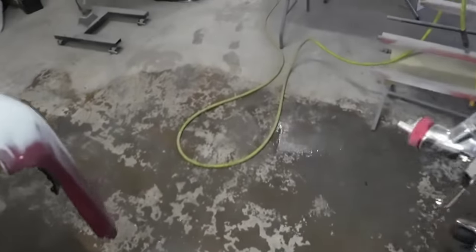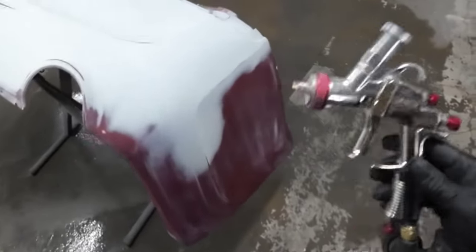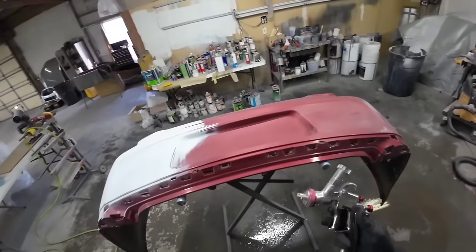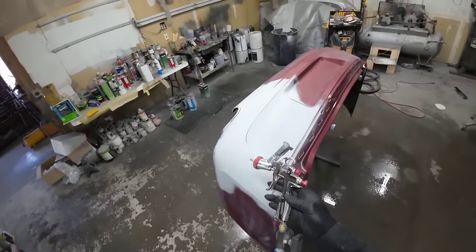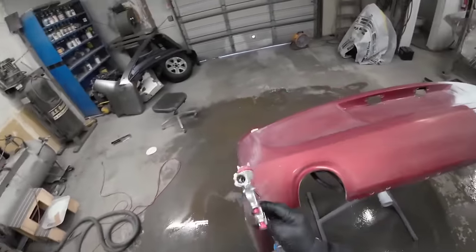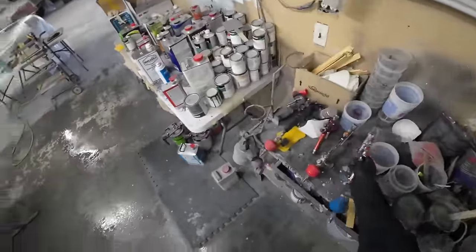This is the paint gun we'll be using today. This paint gun has been rebranded under a bunch of different names, but you can find it under the name R500. I will have links in the description, but you can find it on Amazon, and I believe you can even purchase it on Walmart's website. Summit Racing sells it as Eastwood, even though those are a little bit pricier. This is a budget paint gun, and the price right now is around $60. I think Walmart even had it for $45 at one point. That is a very attractive price for a paint gun as unique as this, and the reason why this paint gun is so unique is that it uses and consumes very little air. If you're using a small compressor at your house, this is the perfect paint gun for you. It consumes about 3.5 to 3.9 CFMs, which stands for cubic feet per minute. This allows you to do a full paint job without any fluctuation in your air pressure, giving you a better quality finish — something you're just not going to get with any other gun, whether it be a budget gun or an expensive high-dollar gun.